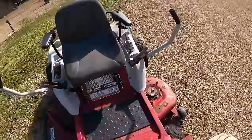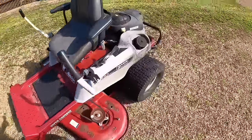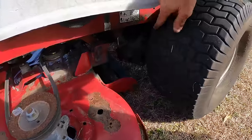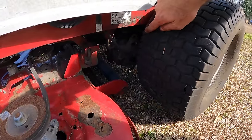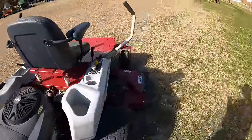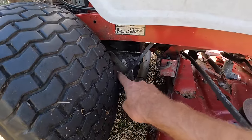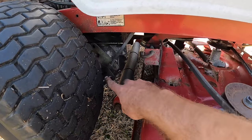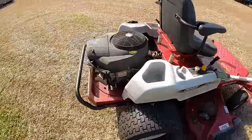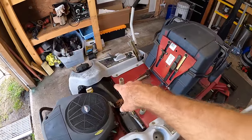I was supposed to put the levers out before I set the brake. Yeah, I'm wondering if the tracking adjustment is off on this one though. Looks like our arm is a little past halfway on that side. Yeah, they're different from each other, so we'll probably have to adjust the tracking on here. The hydro sounded good. All right, so we're gonna get going on figuring out what's going on with that side